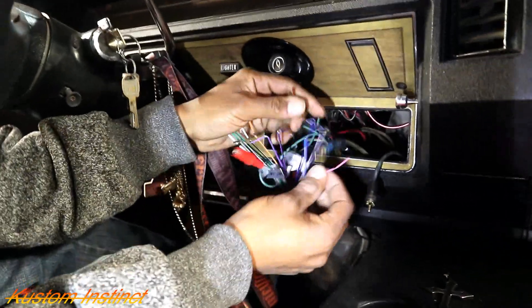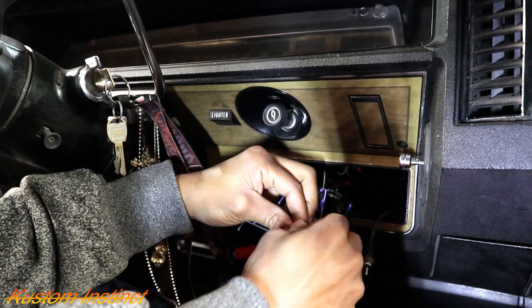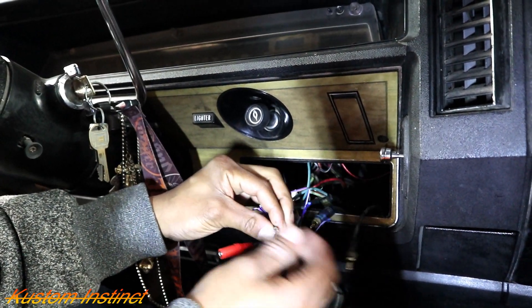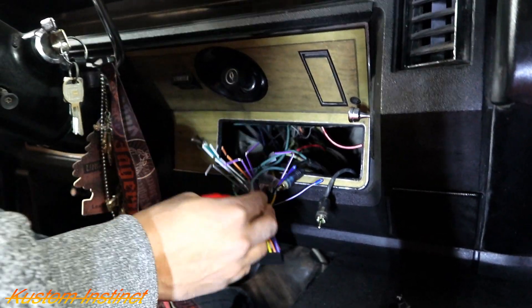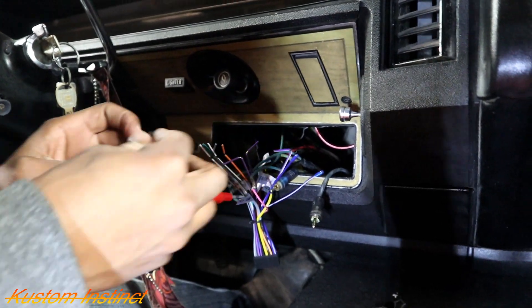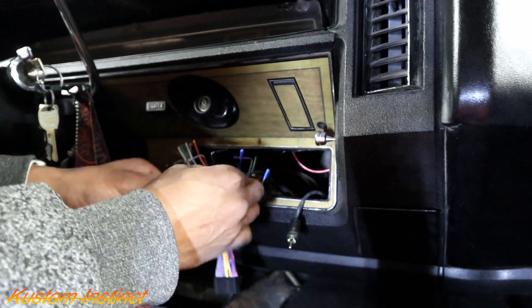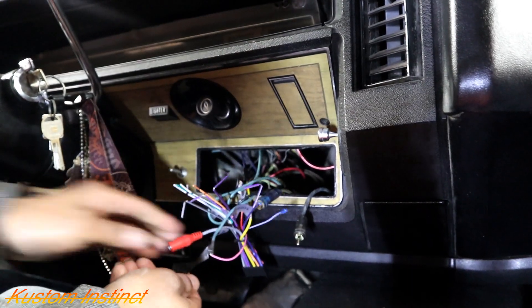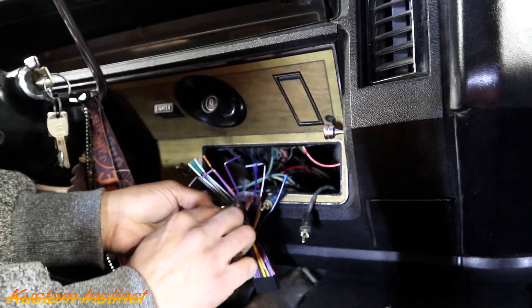Alright, so we know where we need to run this wire — go to the pink. And those wires do have hot running through them, so we need to at least tape them. Oh, now they're covered. Well, good job Jensen — y'all thought about something, because usually you gotta tape those up if you're not gonna use them. You don't want them touching stuff. Alright, we got our parking brake wire hooked up, we got our ground hooked up, we got our power hooked up.